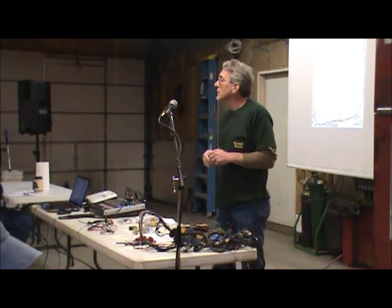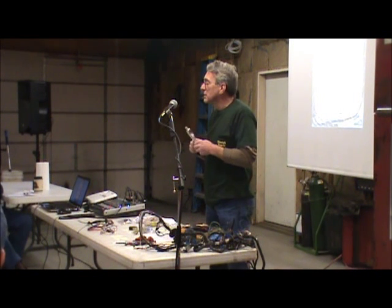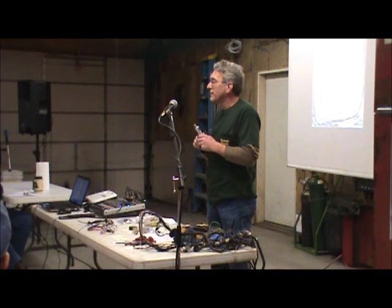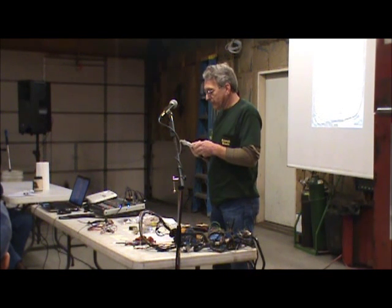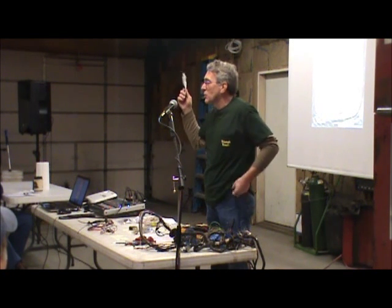I call it copper shell. They work with Corvettes. It's the same thing, but it's copper embedded high temperature grease. Okay. And I do it with each light bulb socket. Yep. I do it with everything I ever work on. If I take it apart, that goes on it. Even battery connections. Right. This is good because it keeps the water out.